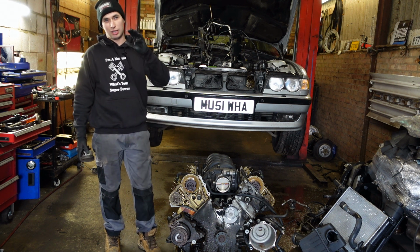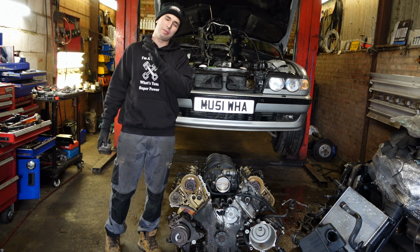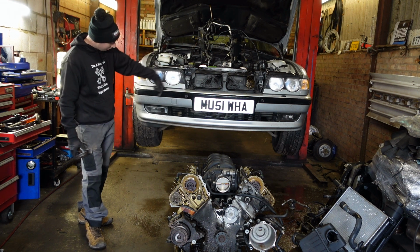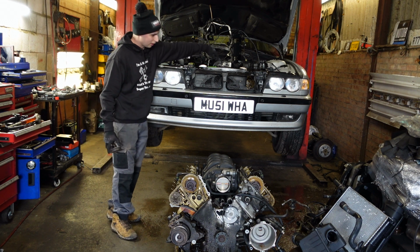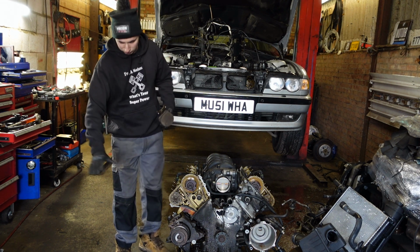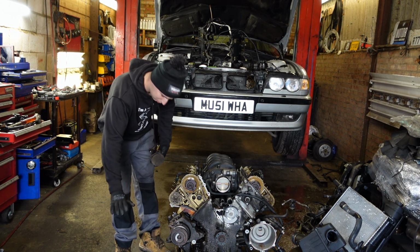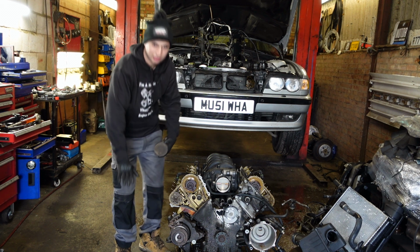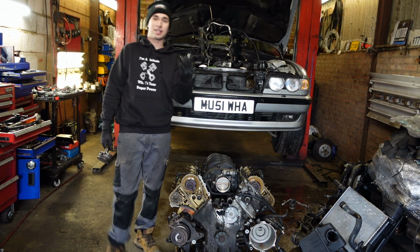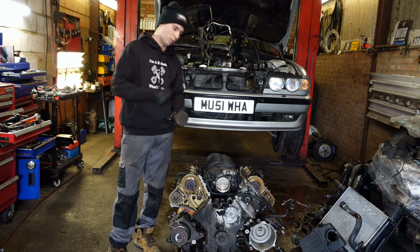And you're also supposed to know how high your intake is. Inspect where you're going, how deep it is. If you're not sure, don't go. In this case, we've got the air intake about here, so the pipe is inside there and it goes around inside the intake. The wheel sits about that high, so if the puddle sits, let's say, about half a meter, the water is about there. Especially at higher speed you're sucking in more air, you drive through, and obviously water gets inside your engine.